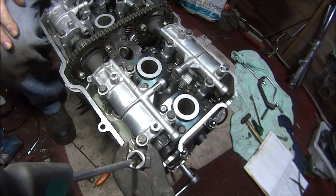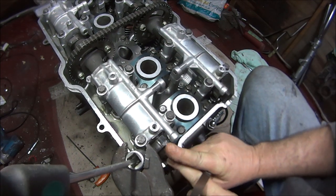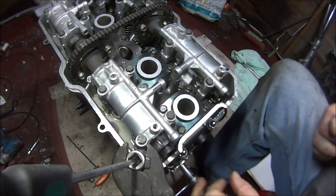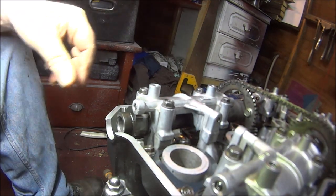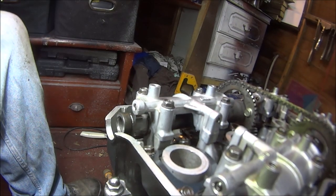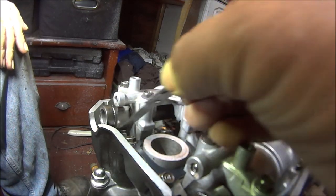And on the tappet that you're setting, just make sure that the nipple of the lobe is sticking upwards, so there's no pressure on the tappet whatsoever. And if your knuckles stick it upwards, you can't go wrong. Okay then, after all that flapping around, I've worked it out. You don't have to get the feeler gauge underneath the actual tappet like normal. You have to put the feeler gauge just under the cam lobe and on top of the follower, and then measure that gap.